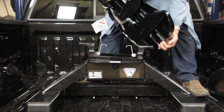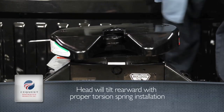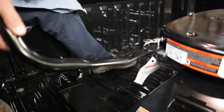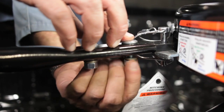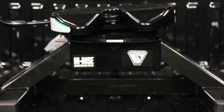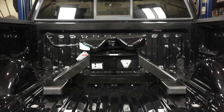We're now ready to put the high-rise conversion hitch head on. Make sure to align the torsion springs correctly. After that, pin the hitch head into place, then take the handle and slide it onto the head and bolt it into place. That completes the assembly and installation of the Bulldog high-rise conversion hitch. Thanks for watching.